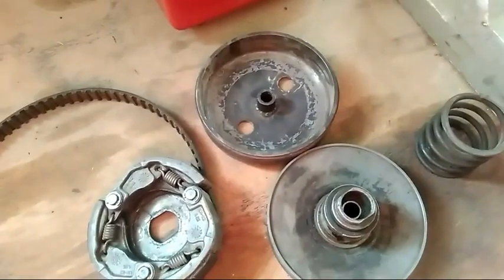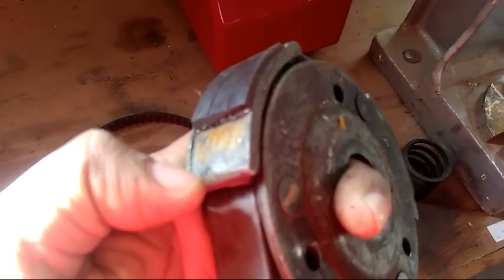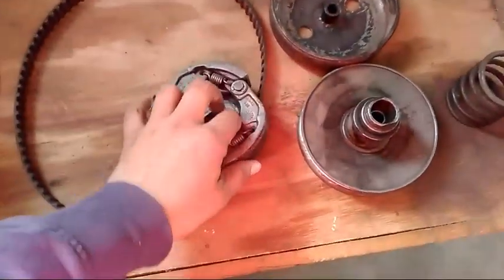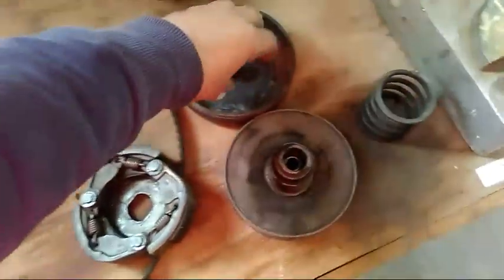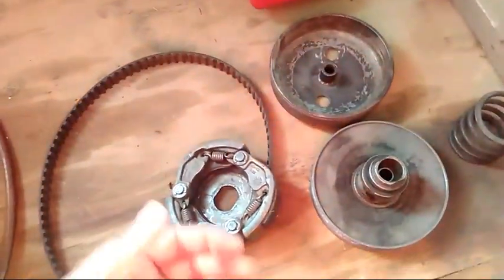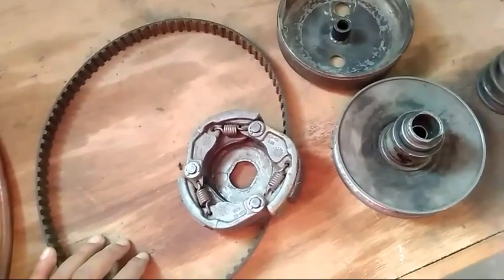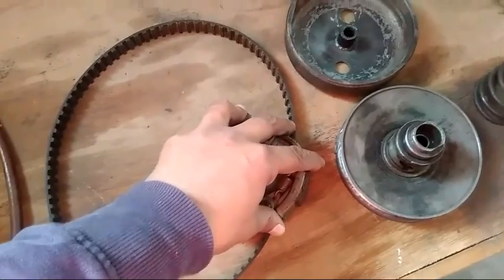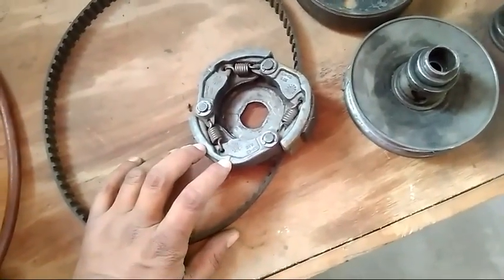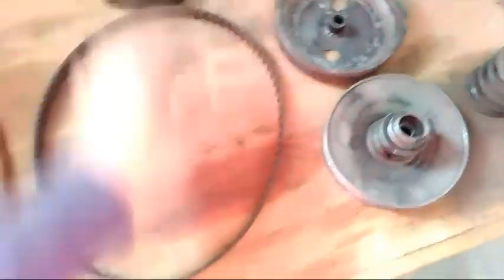When the leather is finished or broken, the squeaking noise is mostly created. When the clutch shoe is worn, the grip is lost — the grip is the only grip. When it doesn't make grip, the rear wheel will not be driven properly, which is also the issue of pickup. And when the pickup is affected, the mileage will also be affected, because the power from the engine cannot efficiently reach the rear wheel.